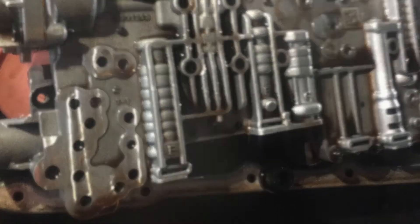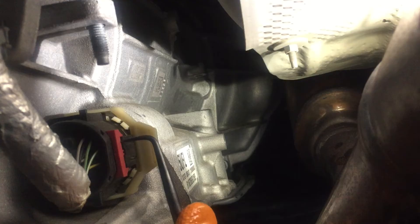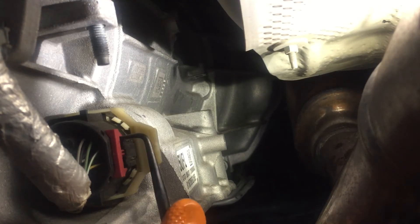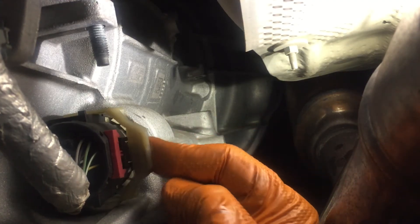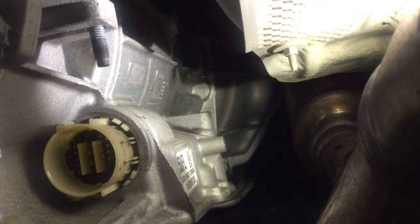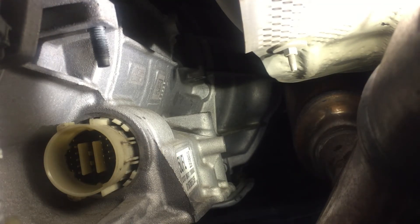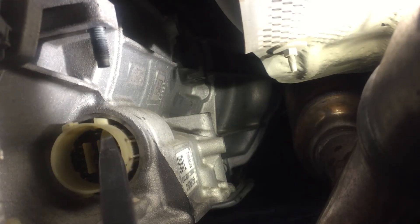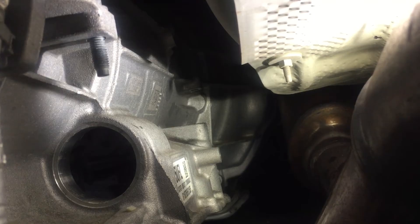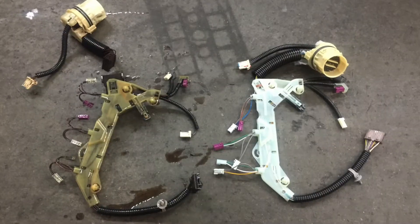Here's what the top of the valve body looks like. Back on the outside of the transmission on the passenger side, there is a red safety lock — pop that backwards. Then press in the black tab and release it; the transmission connector is now disconnected. Since we are replacing this harness, it doesn't matter if we damage this connector. Just take a big screwdriver and a hammer, put it in there and knock it out. This is much easier than trying to release all the little tabs around the outside. And there you have it.